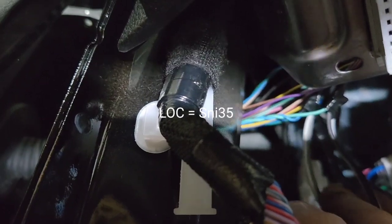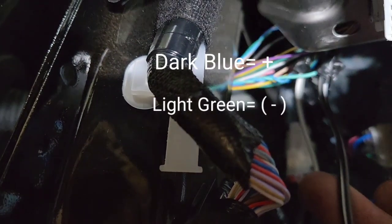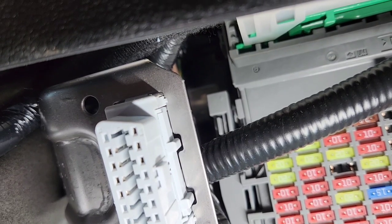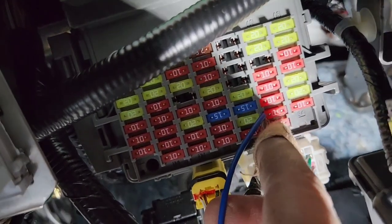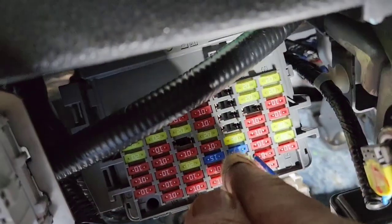The previous install has the SNI-35, which will work. The positive is dark blue, hooking up to the solid color — white and gray. The light green is the negative, which is gray-black and white-black. You just tap them together like that and run the RCA jack. He's got the remote on top. Always make sure there's no wire touching — see how this wire is touching? I'm going to remove that and fix it up so it won't touch anything else, because if there's a short, it's going to short all of them. I'm going to trim that out right there.